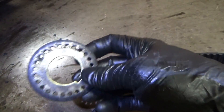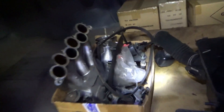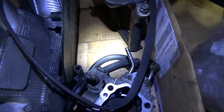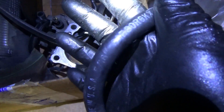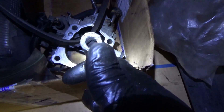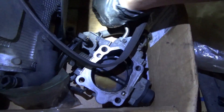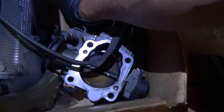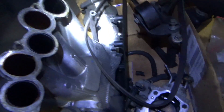We're finding a lot of mistakes — opening up an old can of worms here. The aftermarket knock sensor, and someone installed a replacement cooling hose made for oil, not coolant. This hose right here — SAE-30 RX-KX, made in the USA — it's a Gates hose made for oil. When coolant was flowing through it and it got hot, it went brittle. Here's a piece that snapped off when I was taking off the throttle body — just completely rock hard. Obviously we'll fix all these things. Old cars can definitely have some surprises stored.